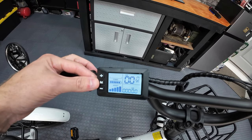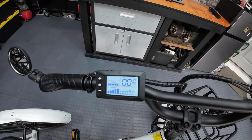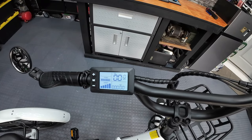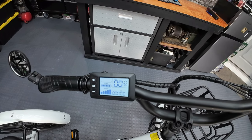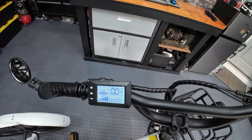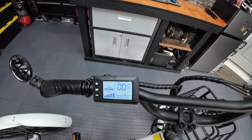And then you've got the current, which will show you the controller current riding around. Most of the time I saw about 5-6 amps on the current. And if you get it under stress, where you're asking it to give more power, it runs up to maybe 18 or so amps, I saw. And it's a 20 amp max controller.